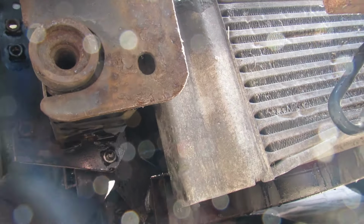These are about £15 each. That one's about 20 to 30. Deflection pulley. This was quite difficult to get. We weren't going to replace this, just a word of warning, because it looked all right, but when we took it off, it rattled like a good one. It sounded quite rough, yeah. It wasn't particularly good. It was like a wobbly front wheel on a cycle. So it doesn't sound that great.